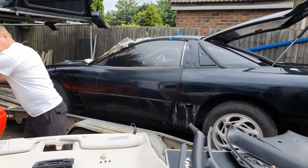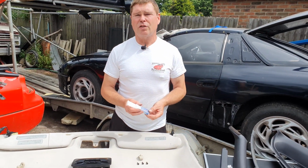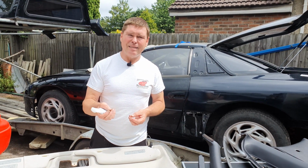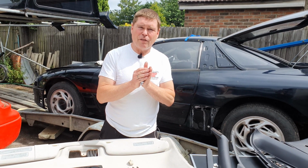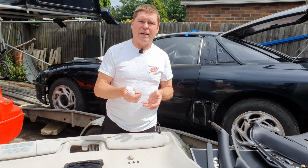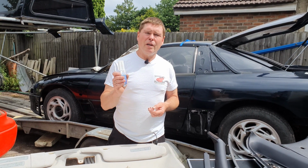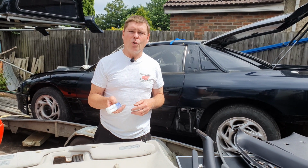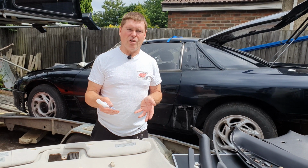And somewhere around here, I've got a tube of it. Okay, this is a multi-part glue similar to the epoxy glues, but this one works differently. This one actually heats the plastic and causes the surface of the plastic to melt, so the two pieces fuse together properly rather than create a glue barrier, which is a weak barrier and often doesn't stick to the plastic properly. So look out for this type of glue. You can ask some specialist in a hardware store or whatever for a correct glue that actually fuses the plastic together rather than glues it together.